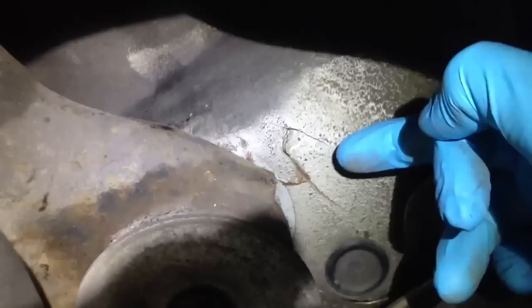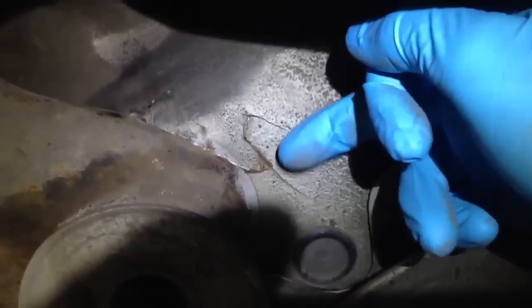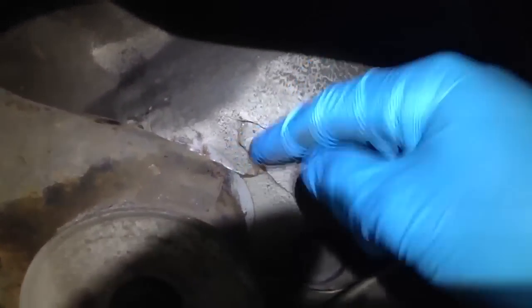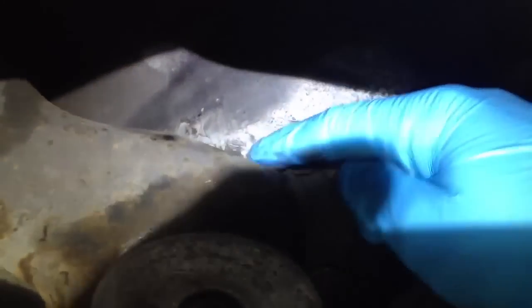What we're trying to show you here is that this is a 318, and it's just on the borderline of breaking out because you can see the cracks. We've got a little bit of corrosion in there. They're fairly good size — that one looks like it'll fold down eventually, and that one looks like it's got a crack going in towards the bush which would open out that way. And there's another one just around the top front edge of that bush.